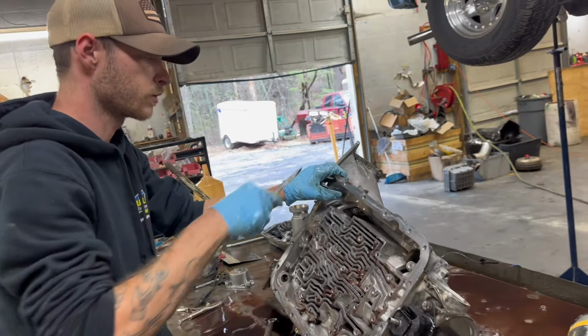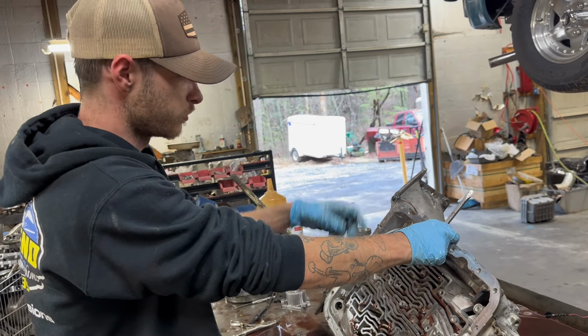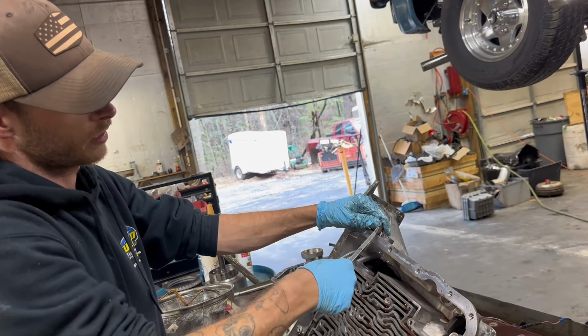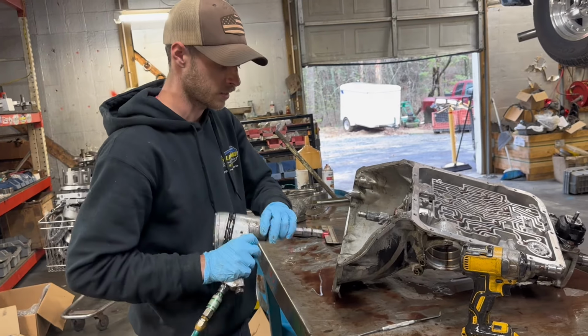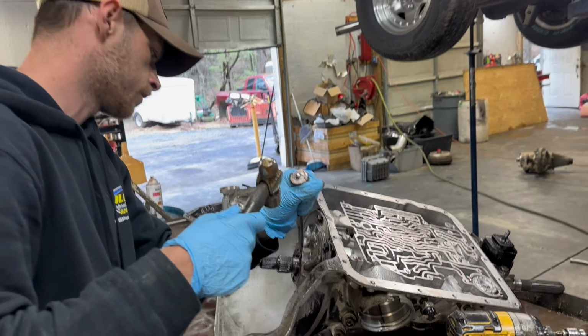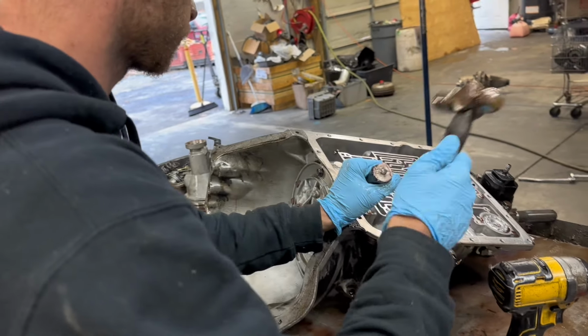This seal, it will leak. I don't care how you gotta beat it out or bend that to get a new one in. You've gotta take this seal out and clean that surface in there. Oh yeah, again, don't hit the casing. Spin behind it.